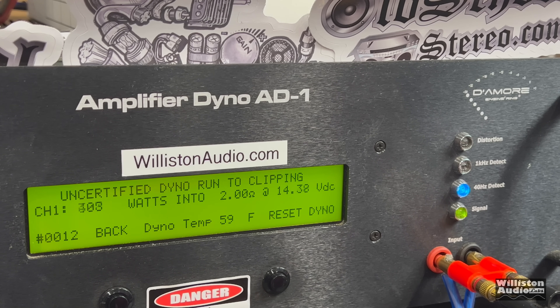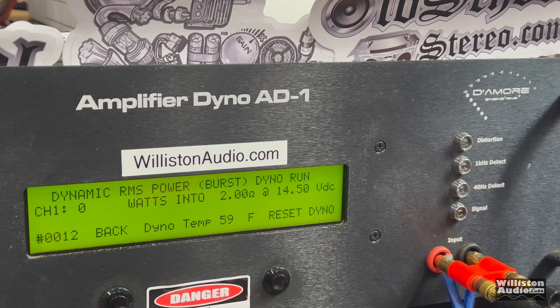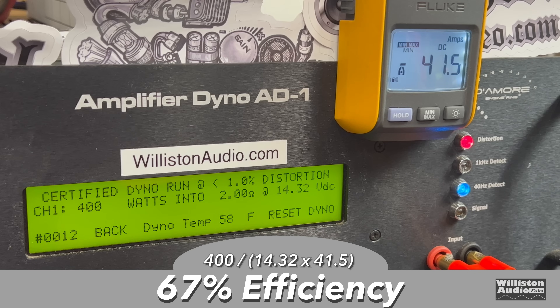Uncertified up to clipping at two ohms with 30-amp fuses — don't try this at home. Again notice it jumped from around 400 watts up to 662 at the very end. Running it again: 429, 436, 449, and then bam — 549, a jump of 100 watts at the end. This amplifier is definitely spiking the voltage for some reason, and that is not good.